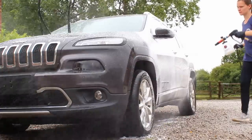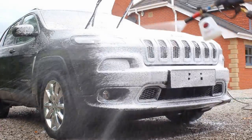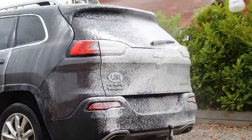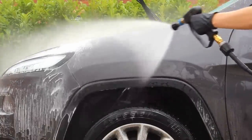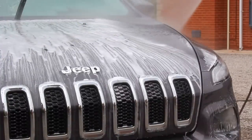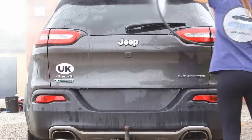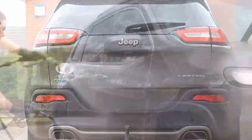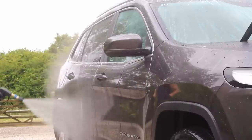To protect the exterior surfaces I used Mile Deep Sheen, their gloss drying aid and foam cannon sealant, applied at a 1-to-10 ratio as recommended for first use. You spray it onto the car, let it dwell for 5 minutes, making sure it doesn't dry out and rinsing sooner if needed. When I rinsed it off there was decent water behaviour — it had more of a sheeting tendency than beading, though I'd have liked the sheeting to be a touch quicker. However, this was applied to a vehicle with zero prior protection, so I can't complain. This product excels more at boosting protection on an already-protected vehicle, where you can use a weaker dilution and get better value for money.